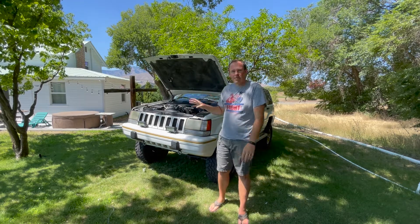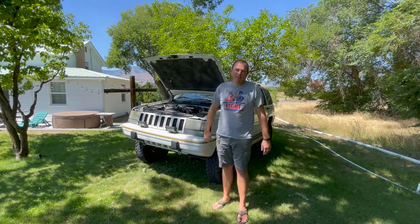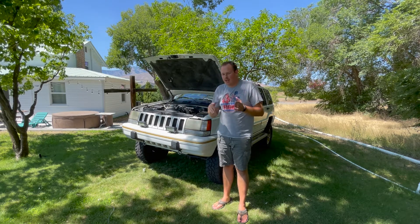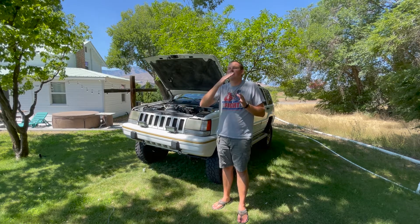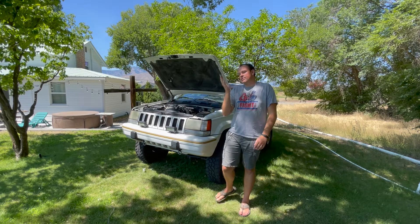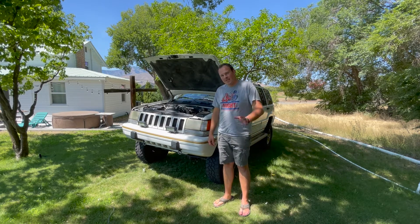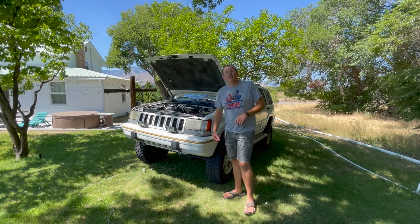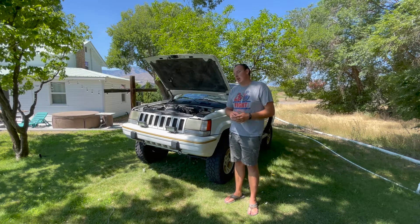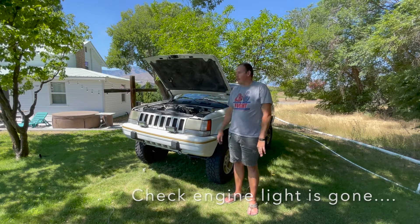I also bought a computer — I think it was $200 or $300, so three or four times the cost of the external regulator. The external regulator ran on this for a year and a half without any problems. It did run it a little bit higher though. With the computer, on your ZJ gauge you sit just below the 14-volt line; with the external regulator you sit right at 14 volts and it would peg a little, so the lights would flicker. But if you need to get off the trail or just need something to get you by, I really think it didn't hurt anything. When I put the computer in it didn't change a single thing — I rewired it how it should be and it works great.